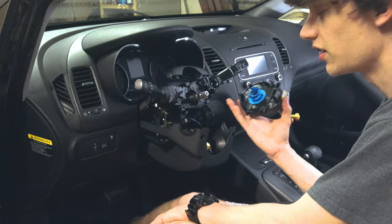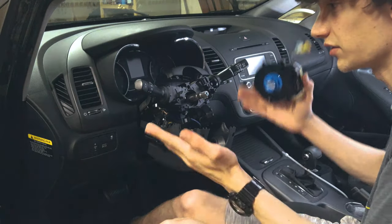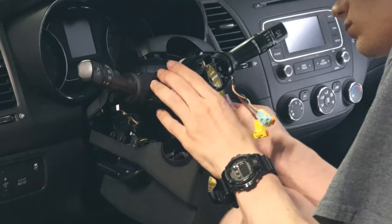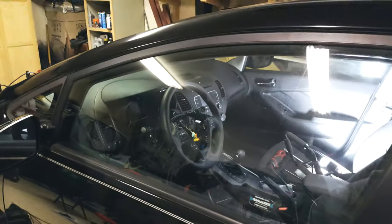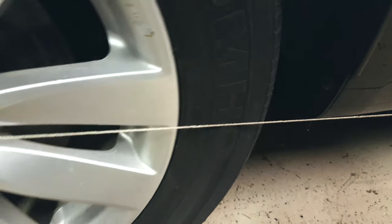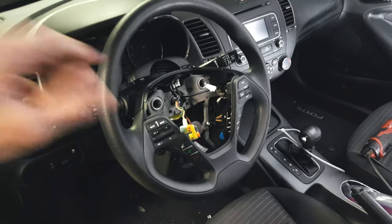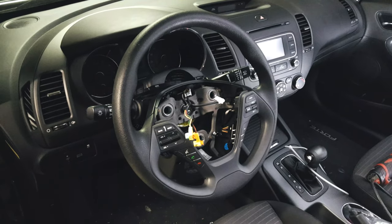When I came back to put this on, I realized I didn't mark the steering wheel, so I don't actually know where it's supposed to sit. I put a string attached to a jack stand, which holds it behind the rear wheel, and then I hold the string up at the front. I know this wheel is in alignment when the string touches the front of the front tire and the back of the front tire at the exact same time. I did this on the other side and it's exactly the same, so that means the wheels never lost their alignment in the crash — pretty awesome. Since the wheel has splines, there's only one other position close to this that I could put it in, and it would be pretty tilted, so this is the closest to straight up and down it could be.